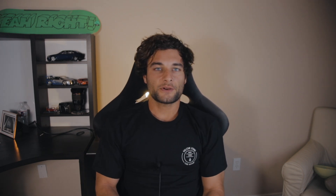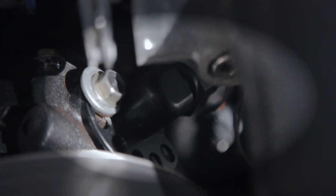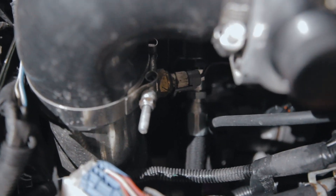You're going to need to install the throttle cable. I started from the gas pedal inside the car, ran the cable all the way to the throttle body, trimmed the excess, and bolted it up. Next, I installed the power steering reservoir relocation fitting and ran it underneath the throttle body and to the right side of the intake manifold. I had to make a little bracket for the power steering reservoir so it could bolt up to the strut tower. After that, I got the coupler, put it on the throttle body, and trimmed all the intercooler piping to make sure it fit correctly.